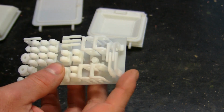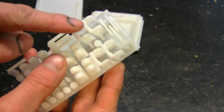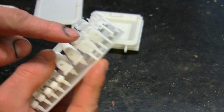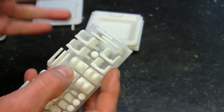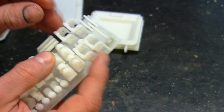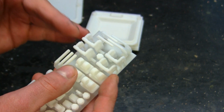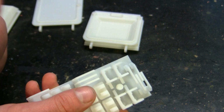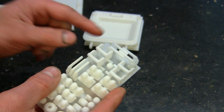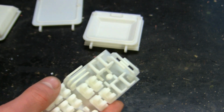So, starting with the bow hatches, again, that takes us to some of the parts that we have here. And note, we have this interesting little device, and this is a hatch stop. The way the hatches are designed on the bow is that they have this nice little unit that's integrally hinged into everything. With the way it works, this actually holds the counterbalance spring, and it assists the hatch with the opening and closing. On top of that, once the hatch is fully opened up, this prevents it from bottoming out when it's opened all the way.